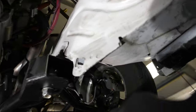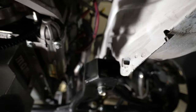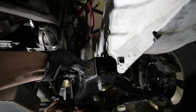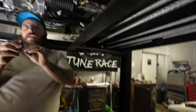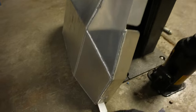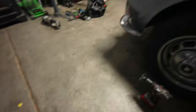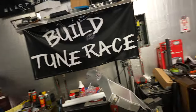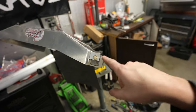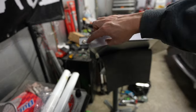We're going to get the mounts tacked on. Plate goes like so. I'm going to favor these down just a little bit because the belly pan touches right here on the back, so we want to get it where it's at right there. They send you this with kind of a whole slotted area to drill your hole, so you can adjust your hole on this one too. I tacked some spots already in there but didn't love it, because this is really tight in the K-member. So I went ahead and favored it up as much as possible, put it up in there, measured how far the brackets need to come out, and the welding will do the rest.